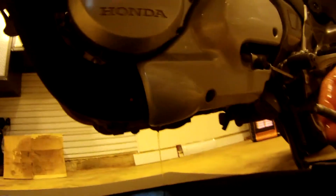Now, note this washer here — there's a little copper washer. You're going to want to note that. You can probably reuse these and they'll be fine, but Honda recommends that this gets replaced. So I normally stock a couple of these. Every time I buy them, I buy five or ten of them, and I can just throw a new one on when I'm doing the next service.